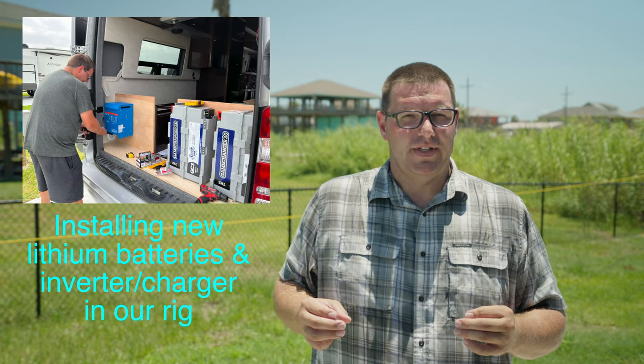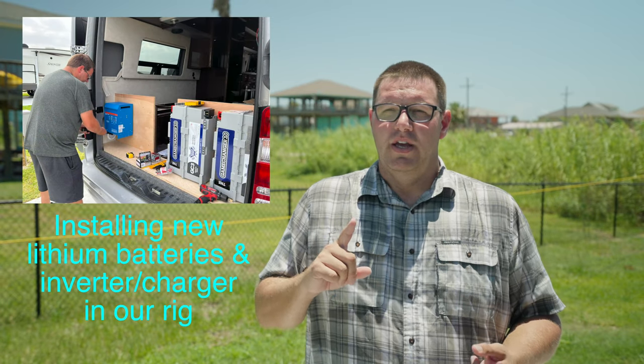The next type is a sealed lead acid battery, which is more maintenance-free. The next step up from that is an AGM battery — an absorbed glass mat battery. It's just a better type of battery; it holds up better and is more maintenance-free. Then the best kind of battery you can get for your RV is a lithium ion, or more typically a lithium iron phosphate battery. The benefits of lithium: they're sealed, maintenance-free, and you can take them all the way down to 0% without damaging the battery — you can use all the power within it.